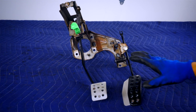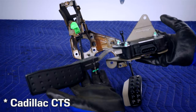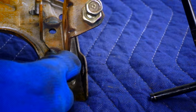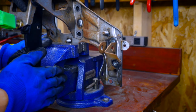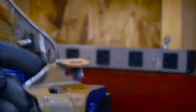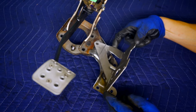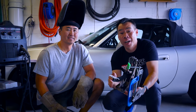The job for now is to modify this thing — to replace this cable-driven gas pedal with this drive-by-wire electronic pedal from a Cadillac CTS-V. I think I'm going to be losing my Flying Miata pedal extension here. Coming over to the trusty bench vise, we need to get rid of this bracket, which is held on by a couple of welds. After a little more cutting and grinding than I thought it would need, here's kind of how it's going to look. This plate is going to mount right about here and the gas pedal will go right about here. And to help me get this welded up, I'm over here at my friend Terry's place.